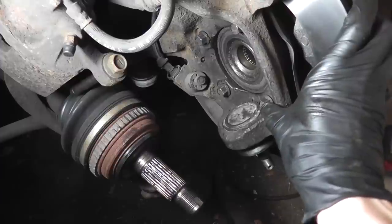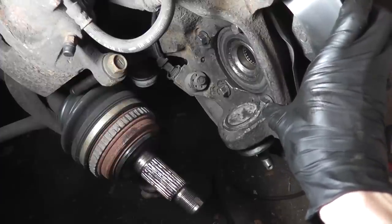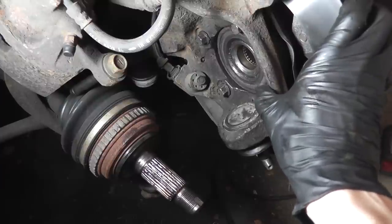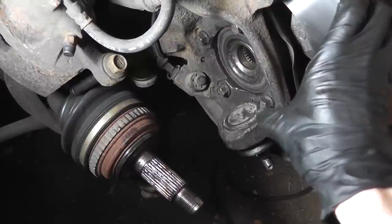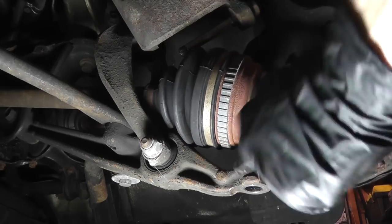For those of you who want to know what the torque specs are for these fasteners, it's 33 foot-pounds, but don't worry about the torque when you're tightening the bolts down to pull the bearing in. After it's pulled in, so it's flush with the knuckle, then you can loosen it up and torque it to spec. Now we can pop the axle and the lower ball joint back in,